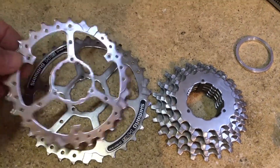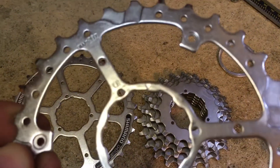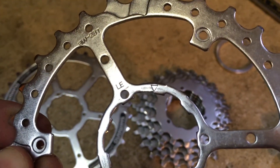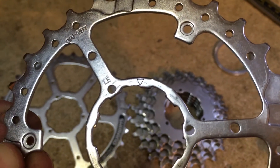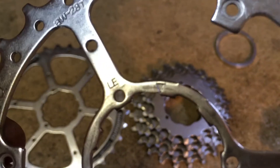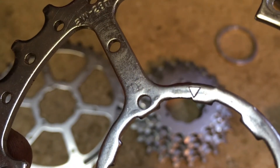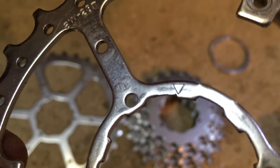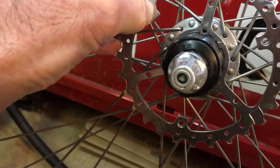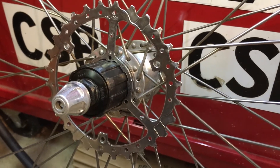You can simply drill or hammer those pins out, leaving you with the loose cogs. At that point you can pick the few that you want to use — I needed five in my case. It's a six-speed bike, but that outer cog is threaded and that's what holds everything together, so you have to use that one. So I used five of the eight, and where this arrow is, I simply filed off half of that wider spline. As soon as you do that, a modern cog will fit an old uniglide cassette. Simple as that.